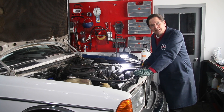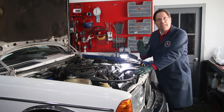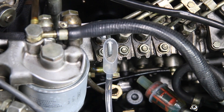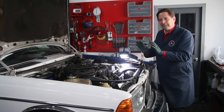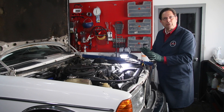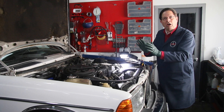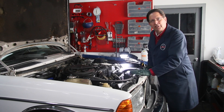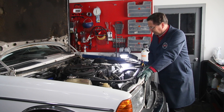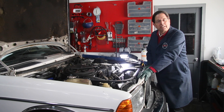I'm not going to set it on the high side because this engine has been recently rebuilt. The 23 degrees I'm seeing is the point at which the drip completely shut off. When it was dripping at one drip per second, I was right about 24 to 24 and a half. That gives you an idea just how critical the timing on that drip is — it's only one or two degrees before it's dripping fast and then suddenly it's off. That's why you have to play back and forward to get this right. I came up with the pressurized system of doing injection pump timing — the high pressure method — and I prefer that because I believe it's more accurate.